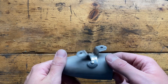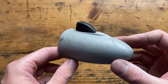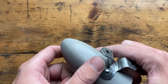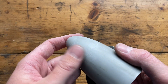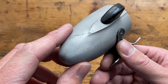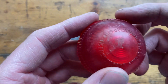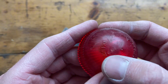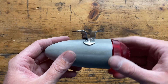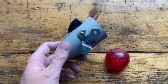Here is the lamp case after I've taken most of the paintwork off. You can see the damage the previous owner — or probably the original owner — had been hiding, probably where the bike fell. You can tell it was originally gray, as I said. I'm going to try and sand most of that out and polish it up. I've already started sanding here. I start with something a little coarser like 320 grit and work my way up. The glass is similarly very scuffed up and will need a good polish. I'm thinking about how to dress it — you want to get it a little bit nicer but don't want to lose any crispness.